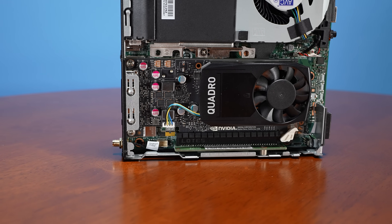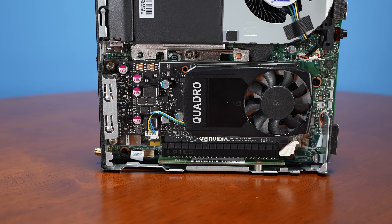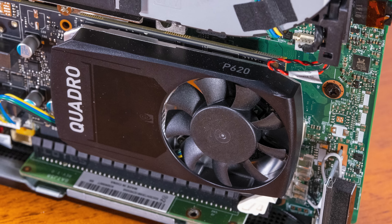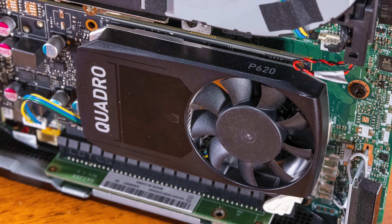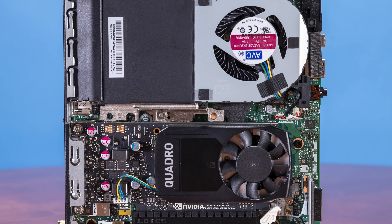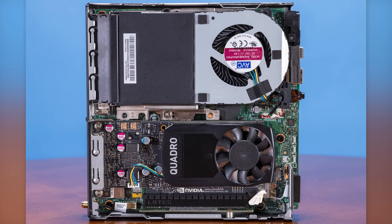I think that if you do want a DGPU, I would strongly suggest getting a unit that already supports it. Lenovo actually uses a more standard riser and PCIe connector instead of a proprietary connector, which I really like. At the same time, I do feel like the P620 is really showing its age — that's many generations ago. I would have liked to see at least a Turing-based GPU as the minimum base level in this generation. The P620 is just really at the lower end, serving mainly as extra DisplayPort outputs.